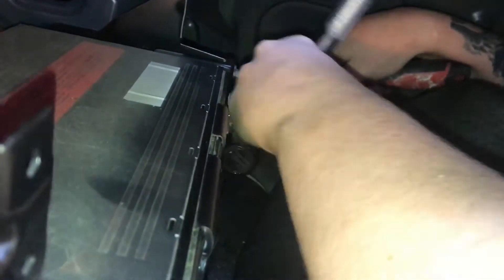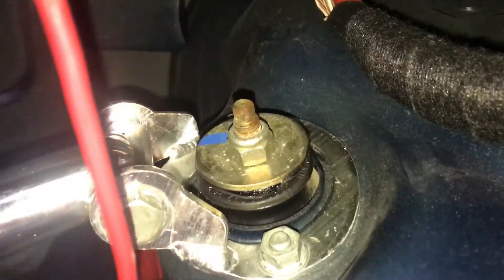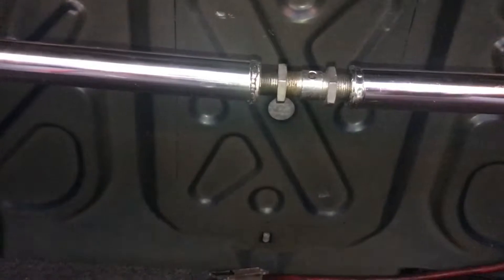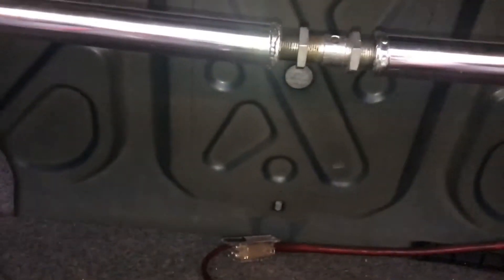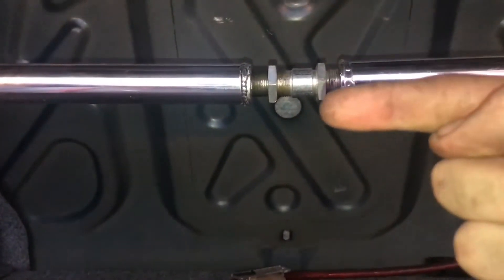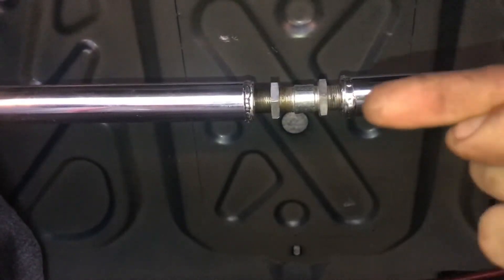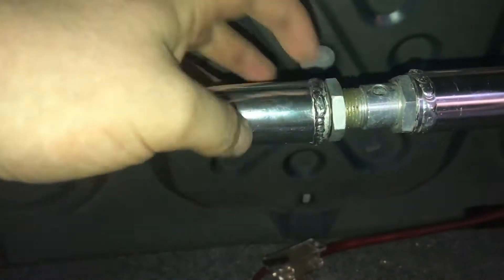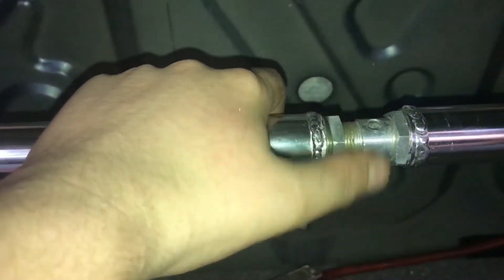It's so hot in here. With both the locking nuts undone you can see it's quite loose, so you need to get a screwdriver on this one — stick it through that hole and just do it up so both of the bars go either end and tighten up together. On this side I've run out of thread but the strut bar is tight and it ain't going anywhere. Just do that locking nut up — get an adjustable or a 25mm spanner on it and do it up until it's tight.